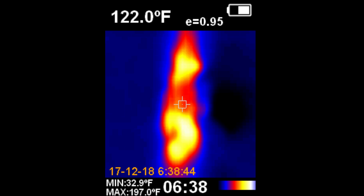An HVAC technician can use this for inspecting ductwork for leaks. Over here we're looking at a gas air handler, and you can see we're shading in the infrared. You can see that there's heat behind that panel — more than likely the pilot light for the gas furnace.